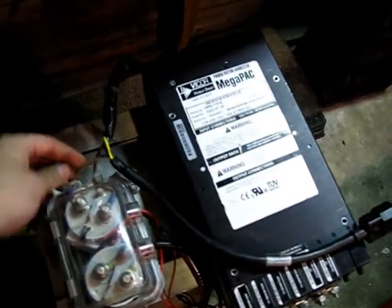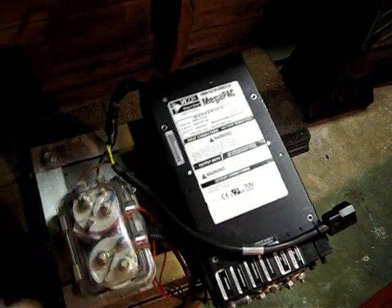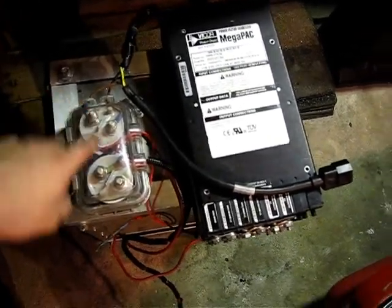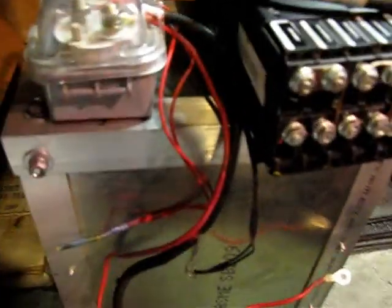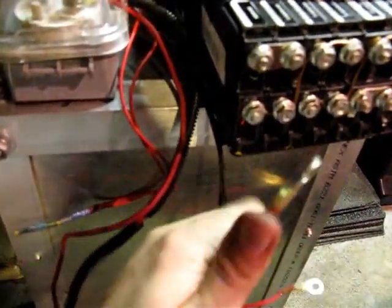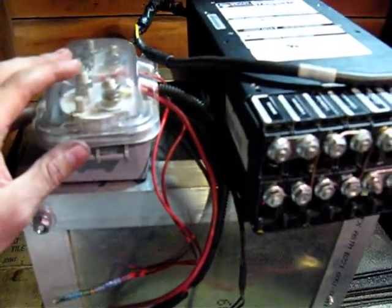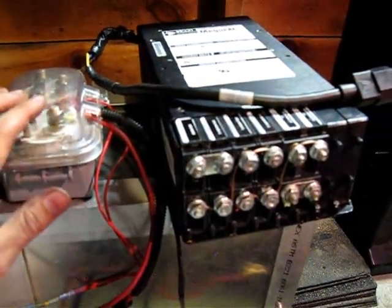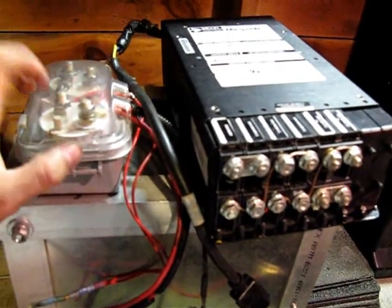That's wired in right here to this contactor. The idea is that you can turn off the whole unit by tripping this contactor — it will be quiet, not make the loud fan noise, and not drain your battery pack. That contactor's purpose is to make sure your accessory battery doesn't get drained through this unit while it was off, because this is a non-isolated unit and the battery would just drain right through it, leaving you with a dead accessory battery in the morning.